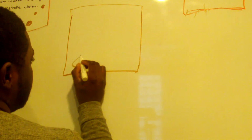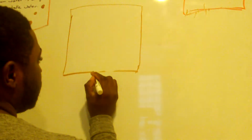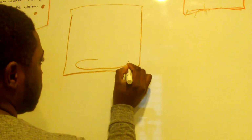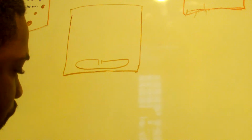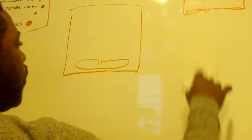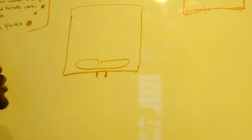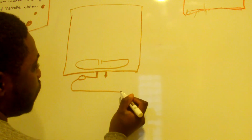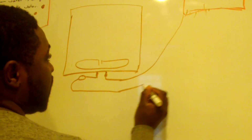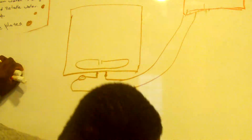There is a heater in there. Actually, I did it opposite. Generally, it's like that, because the back of the heater where the connections are is on the inner side, towards the wall inside of the dishwasher, and it hangs at the bottom. That's why sometimes it's hard to troubleshoot, because it's too far from you, right? And that heater also has a thermostat in it. What I generally do is test the thermostat here for continuity, to see if it's closed inside.